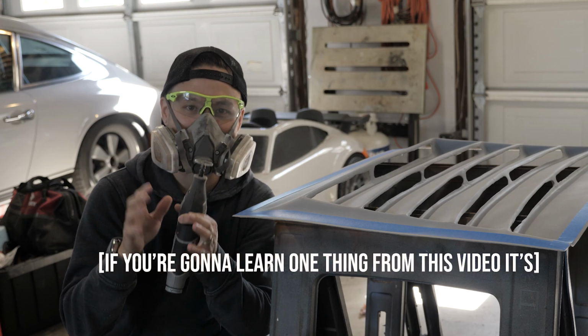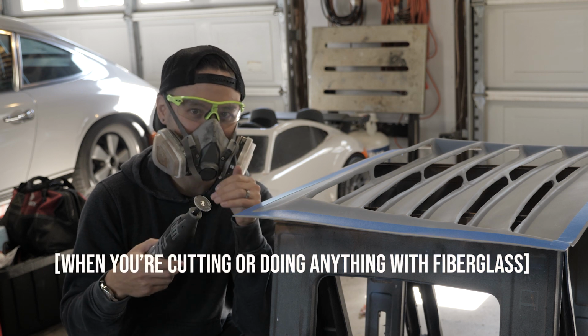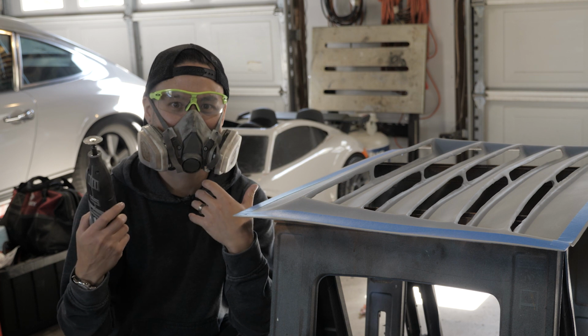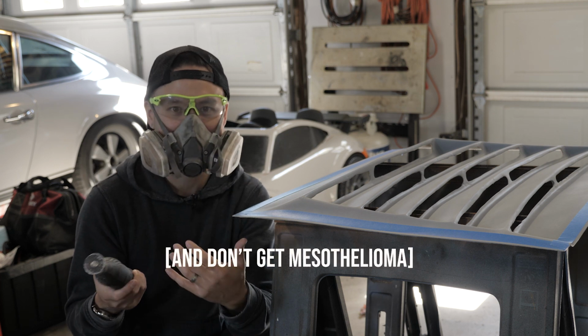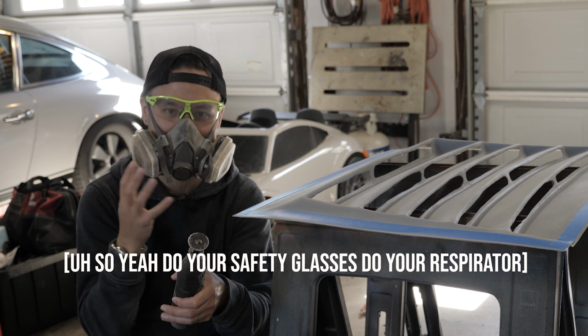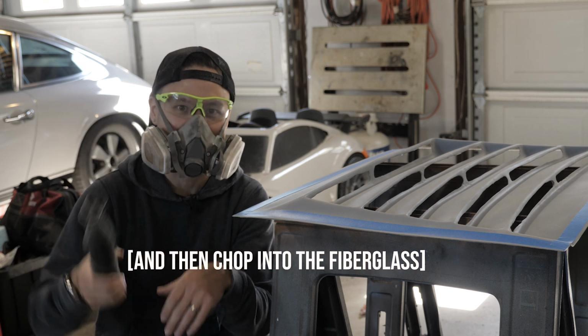If you're going to learn one thing from this video, it's when you're cutting or doing anything with fiberglass, put the respirator on and don't get mesothelioma. So yeah, do your safety glasses, do your respirator, and then chop into the fiberglass.